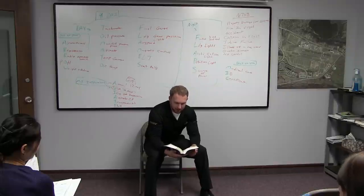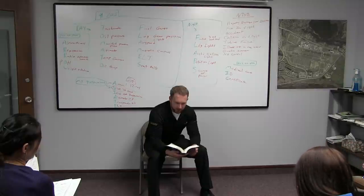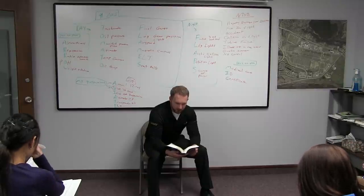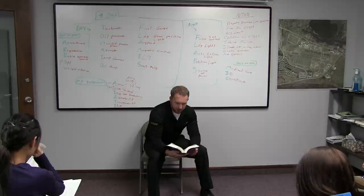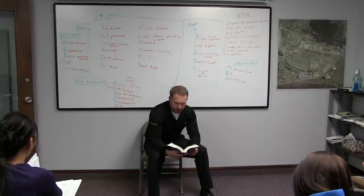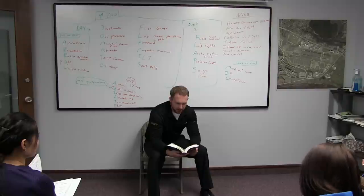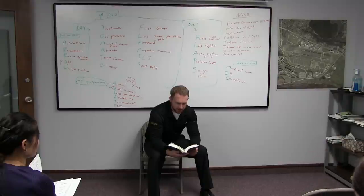Substantial damage means damage or failure which adversely affects the structural strength, performance, or flight characteristics of the aircraft, and which would normally require major repair or replacement of the affected component. Engine failure or damage limited to an engine, if only one engine fails or is damaged, bent fairings or cowling, dented skin, small punctured holes in the skin or fabric, ground damage to rotor or propeller blades, and damage to landing gear, wheels, tires, flaps, engine accessories, brakes, or wingtips are not considered substantial damage for the purpose of this part.